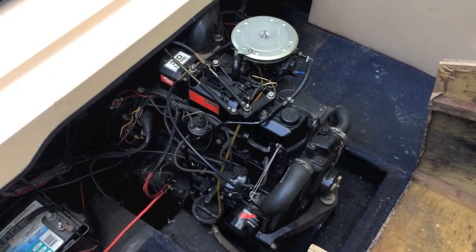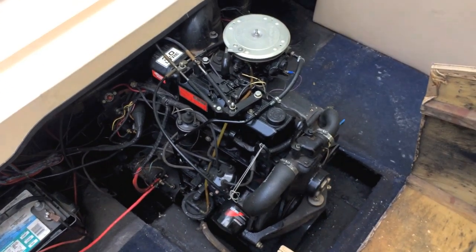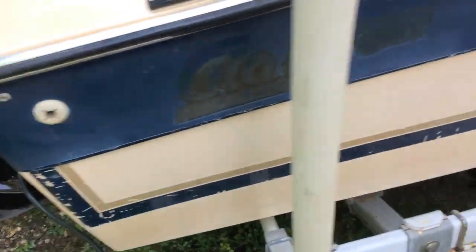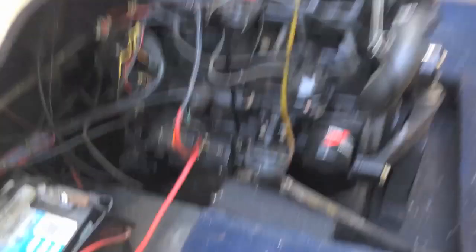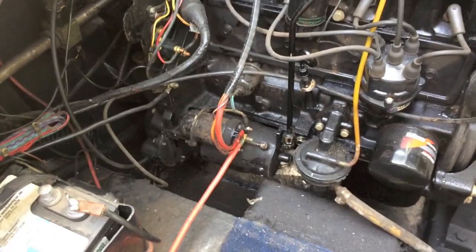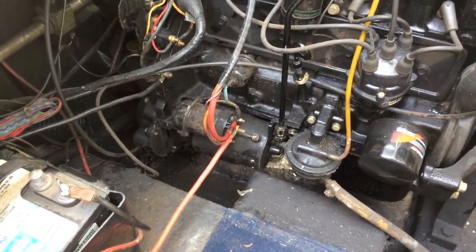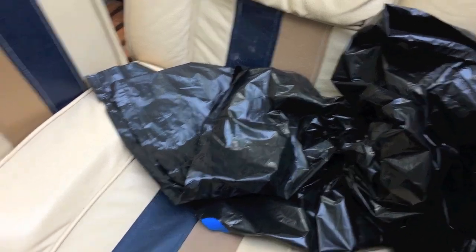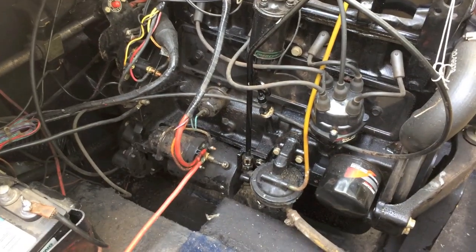It's also a good time to take a look at everything while it's running. I let it run for about 20 minutes to warm that oil up. Next, down below is your drain plug — and it's a little tricky to position an oil pan down there. Some people use an industrial-size durable trash bag, which I'm going to use today because I don't have a pump. Others use a hand pump to siphon the oil up and out.